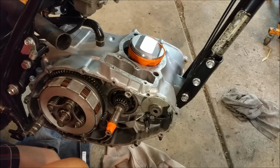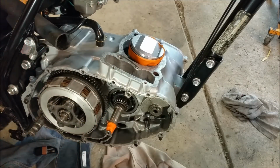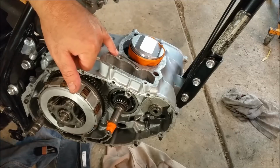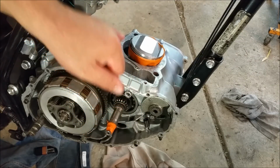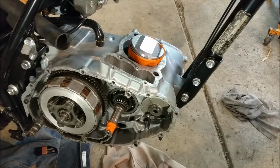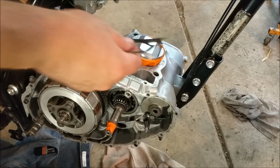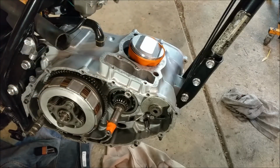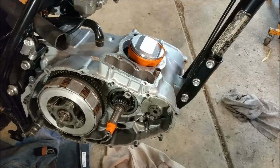One of the things on these XLs, 750s have them in the head, is this oil restrictor here. Now, what happens, oil comes up through here. No, it doesn't. It comes up through here, travels along that gallery, and then up into the cylinder head. So when we put the gasket on, they correspond with those holes. If it looks like it's not going to correspond, it's wrong. I'll get the dowels first, just a moment. So I've got one there, I think, and one there.